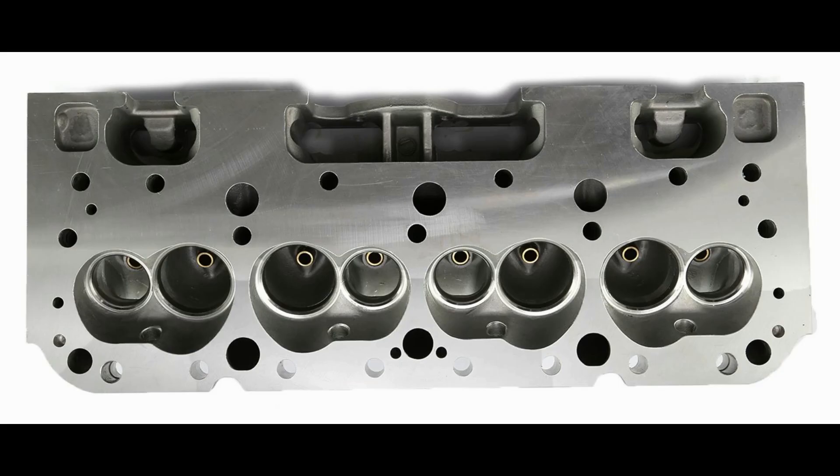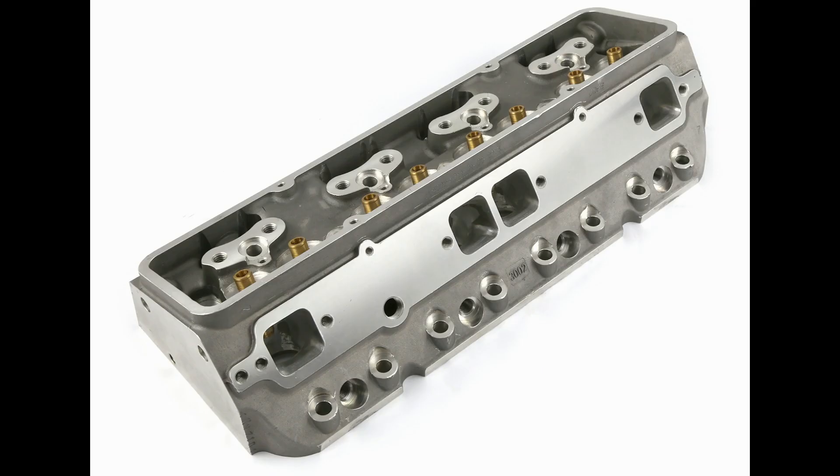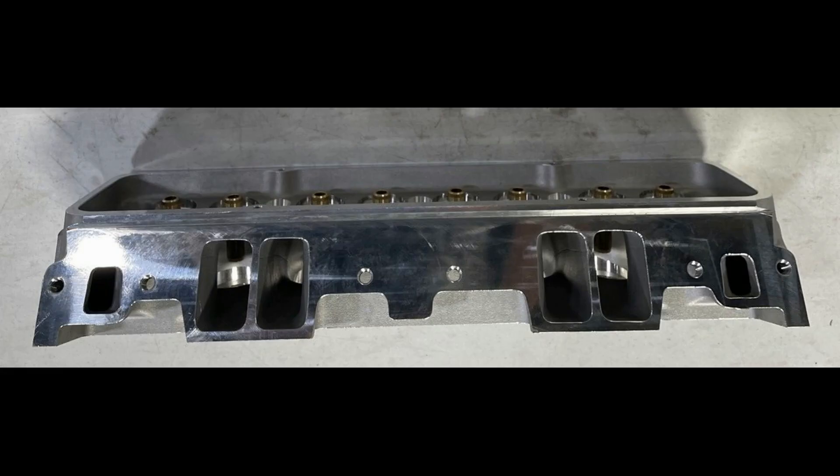Going back to the Speedmaster head, you can see the deck is different. I'm not going to point out all the differences here — you can pause if you want. The Speedmaster exhaust side has no D ports, has the common coolant port, and even has a cast part number. I'm pretty sure these eBay mystery heads are not Speedmasters, for several of the reasons I pointed out in these pictures. If they are cast by Brodex, or even copied by someone else, then judging by the intake ports, I'd say they are the 200cc version of the Iron Killers.